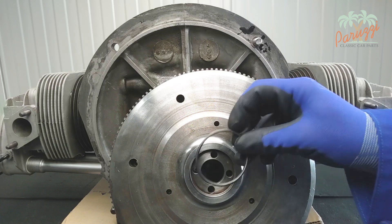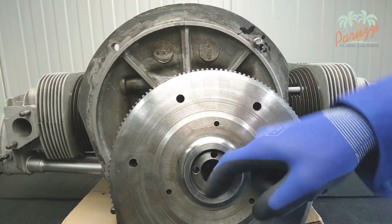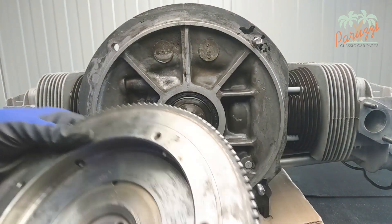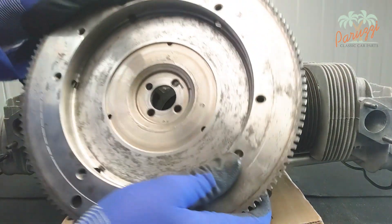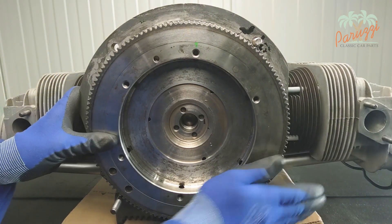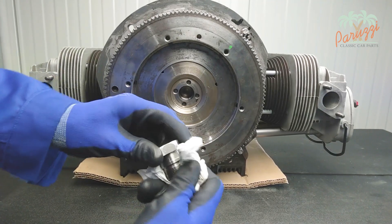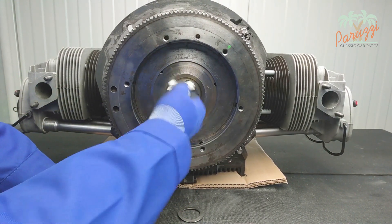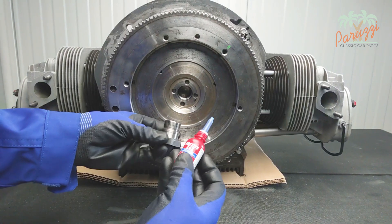Place a new O-ring in the flywheel if your engine is equipped with one, making sure that this rubber ring touches the flywheel well all around. Slide the flywheel over the four flywheel dowel pins, remembering to match the markings on the flywheel with the markings on the crankshaft. Push the flywheel manually — the gland nut will soon push the flywheel further over the dowel pins. The flywheel will also clean the inside of the crankshaft where the gland nut will soon be attached.